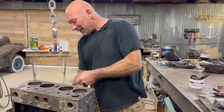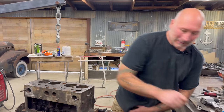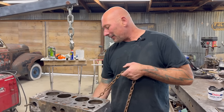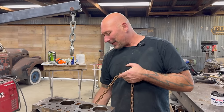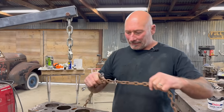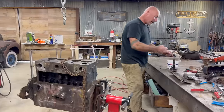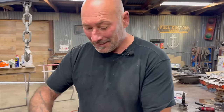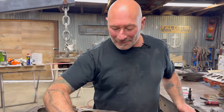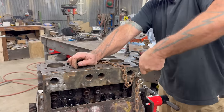There are some issues with the bearing clearances that I'm just not comfortable getting into — where you put this little Plasti-gauge, it's like a little plastic ribbon that you compress inside the bearings. I'm not familiar with that business at all, so if I'm not comfortable with it, I'm not getting into it. Put a chain on this engine and mock it up in the Jeep. A couple broken studs in here too — that's a bummer, but we'll repair that. The thing that holds the distributor in place — that one's broken too.